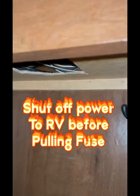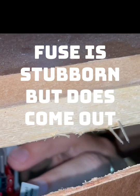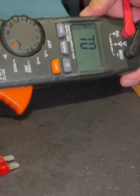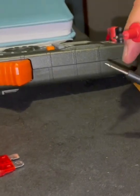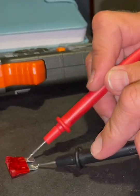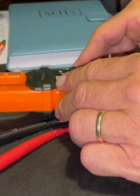It's right on the left-hand corner of the radio — really accessible by hand to pull it out and replace it. So I'm doing this test: I have my multimeter out and I'm testing continuity. This is the continuity test — there's a digital sound if there's continuity, we'll get a beep. If there's a connection inside this fuse I'll get a beep, and I'm not getting a beep. That means that fuse is broken, and I can actually see that it's broken in there. I'm going to replace that fuse.